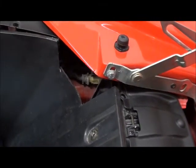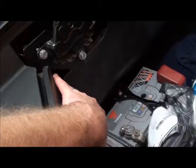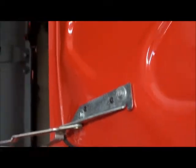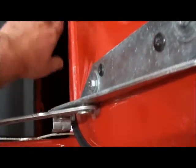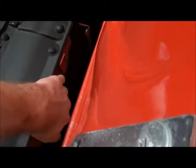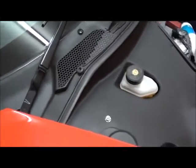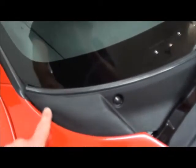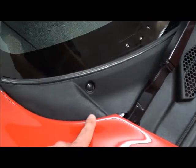You can see I had to cut under here — could have done that neater, but Wood Sport did that so you can get it in and out. I've kept the standard looking wipers. I've had to lower this and extend my scuttle cover down — it normally ends about here and you'll have a similar thing to do. I recommend putting a bit of plastic underneath and filling it in with rubber flexible filler, then spraying it in textured paint. There are various bits of filler to do as well.